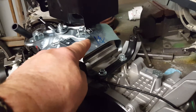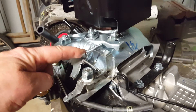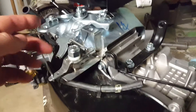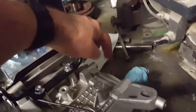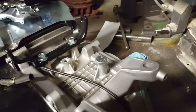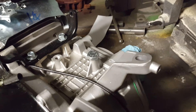I wanted to reuse this throttle because I like the idea of having this adjustable screw where I can regulate how high the engine revs just by using this screw — I don't want to rely on a governor of sorts. Also, because this is going on a mud motor, it's eventually going to have a shaft coming off here that I don't want to constantly be taking on and off. It's too inconvenient, and I wanted to get the governor removal out of the way before I did that.